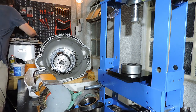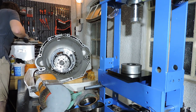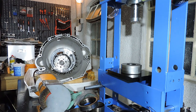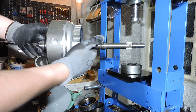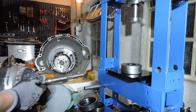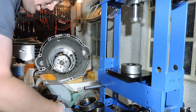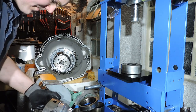So let's see what we have now. After the planetary gear set, I've got the E-clutch. Alright, got it, E-clutch coming up. This is actually the final pack that you're doing, because after this we're already moving to the pump. You can see the entire assembly right here. This is the input shaft and there's another intermediate shaft. So, let's take it apart gently. And we're gonna have to do some O-ring work again.